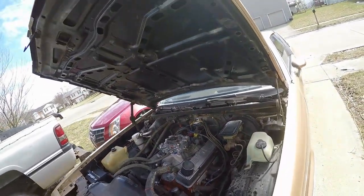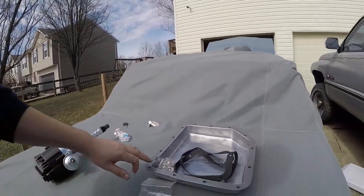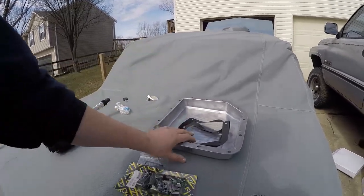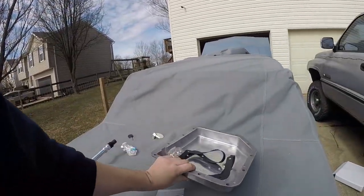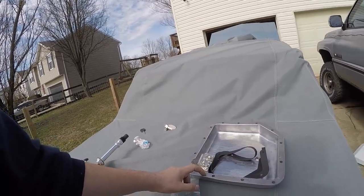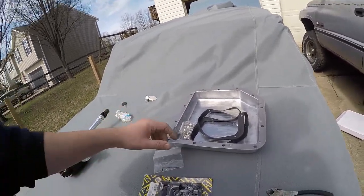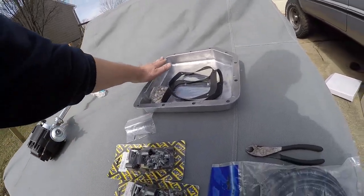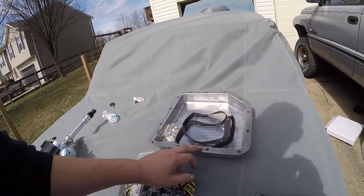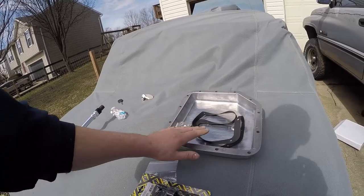The other thing we're going to do is address a transmission leak. These transmissions seem like they leak a lot, especially if a car sits for several years — if you've got a cork gasket or even a rubber gasket, they just start leaking after a while. So we're switching to an aluminum transmission pan. The edge of this is flat. Your factory steel pan has raised edges between all your bolt holes, made to pinch the cork — and those end up leaking after a while. We went with the flat rail and we're going to use a good gasket maker called The Right Stuff. Without those raised edges we can just use that gasket maker, and that stuff will last forever — it'll never leak again.